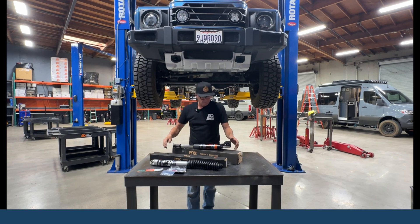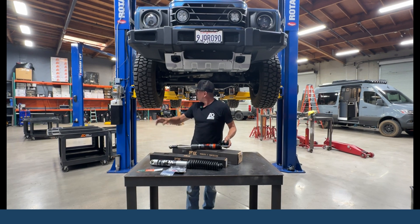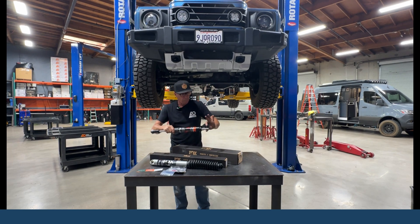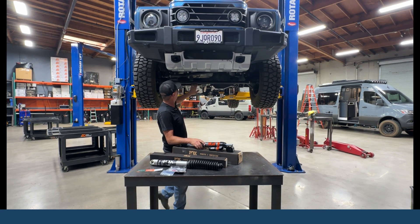The ATS — more new technology. Important things to note: we've made stainless steel spacers for the right size bolt, because there's a 12 millimeter bolt on this side of the vehicle on the axle, and over here there's a 14 millimeter bolt, and that 14 millimeter bolt goes right into the brackets. This just bolts right on.